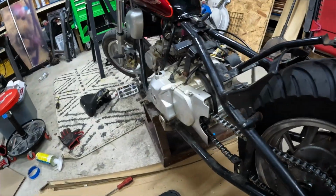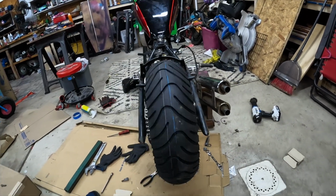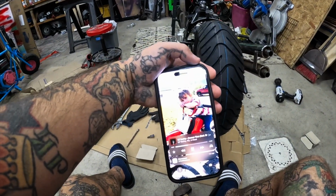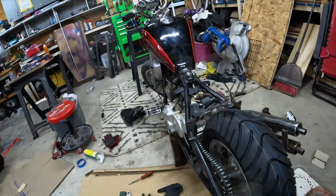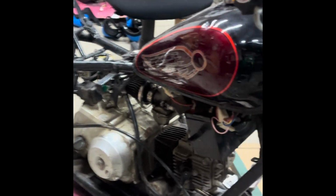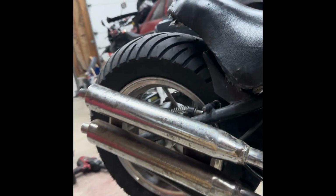Like I said, got the engine mounted. Yeah, wheels nice and straight. It's getting good. We've only been working on this maybe 2 or 3 hours. Got it pretty much done. Well, at least able to ride. So the throttle's sticking on this at full throttle, and the only way to stop it is to choke it out. So I got a new carb and throttle we're going to be throwing in. So that's going to be this next video right here.